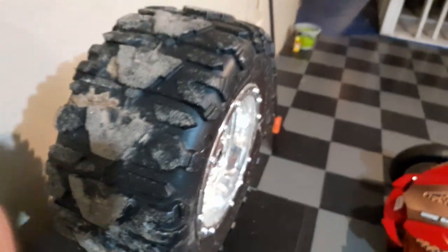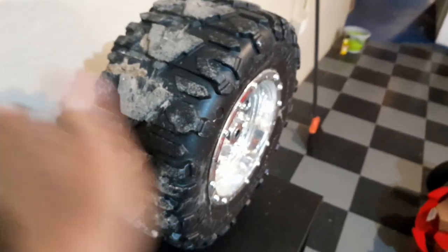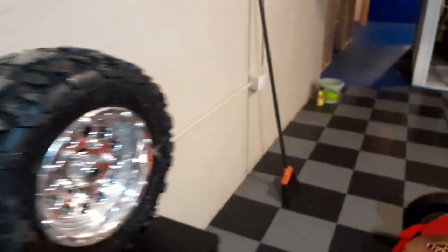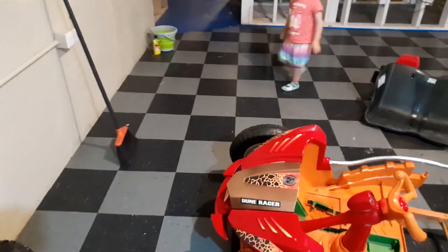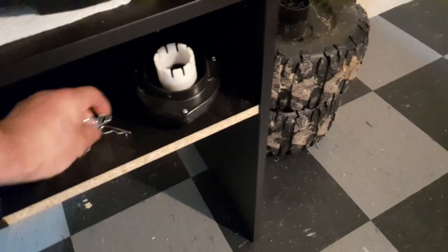When we're putting a lot more power and speed behind it, these wheels are not really meant to take horizontal loads — they're meant to take loads this way, but not horizontal like this. You get higher coefficient of friction in rubber wheels, and when you start moving them side to side, the pins that hold these plastic wheels on were really not made to handle that.